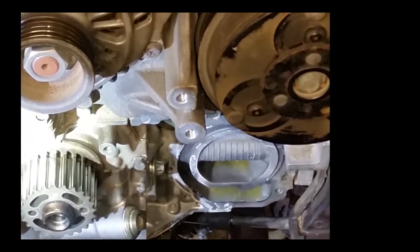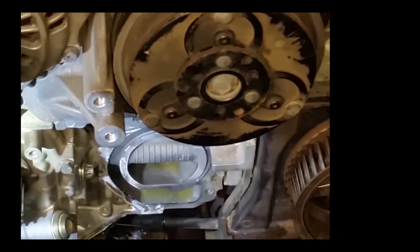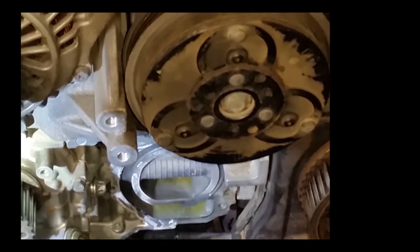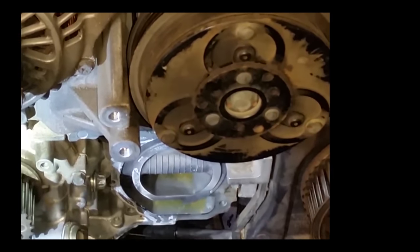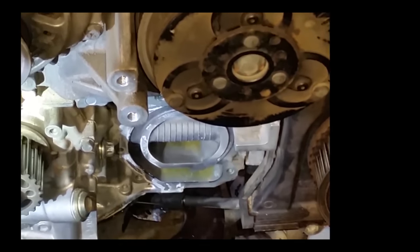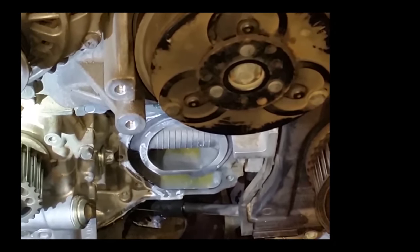But I found that when I was putting the water pump in yesterday, the bolts all tightened up except for that one. I did a two-step, 60 inch pounds, and then went to 108 inch pounds, and that one just wouldn't tighten up. So pulled it out. The way the threads were gone, I never pulled any threads out, so I don't think it was me that stripped it, but it looked like it had been done before. When I removed it, I didn't notice that. But go ahead and try to finish this up today. Get it done.